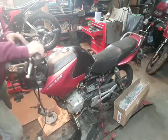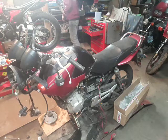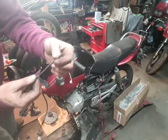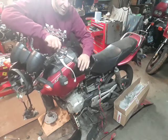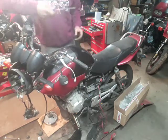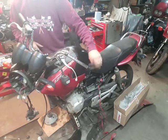Right. The grip, got to make a bit of a twisting action to get it off the handlebars. It's not coming off too easily, so I have a technique, yet again. Get a reasonably thin screwdriver, this is about a 5mm thick screwdriver. Push that down underneath, try not to damage the inside of the grip. Then spit down inside it and pull the screwdriver out. This will give that end a little bit of lubrication, and as the actress said to the bishop, good bit of lubrication, and it slides off in and out easily.